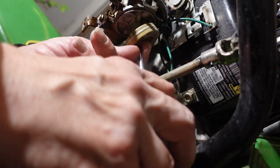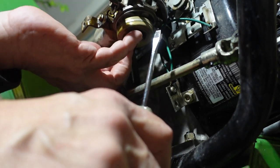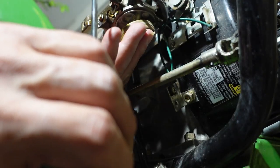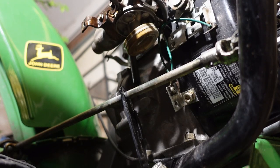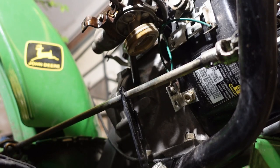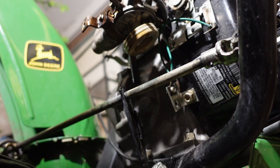A little change of scenery. What I'm going to do is try and take out the piece that is in here if I can. I may have to just try this without taking it apart, which means I would have to take it off and do a lot more thorough cleaning. If I can just get it running for a while, I can make sure that it can at least start and run when I need it while I wait for a new carburetor to come in. So I'm going to spray some more carburetor cleaner here in the throttle body and more or less hope that will give it a little more oomph when it's trying to run.